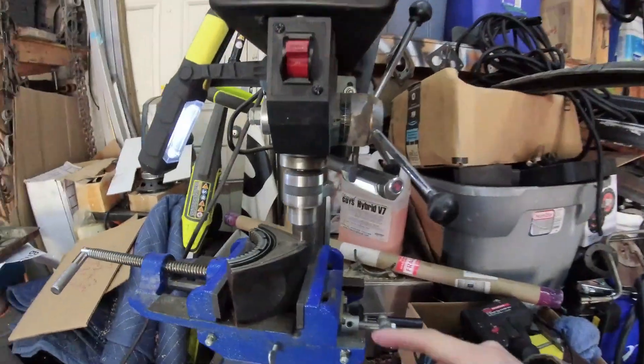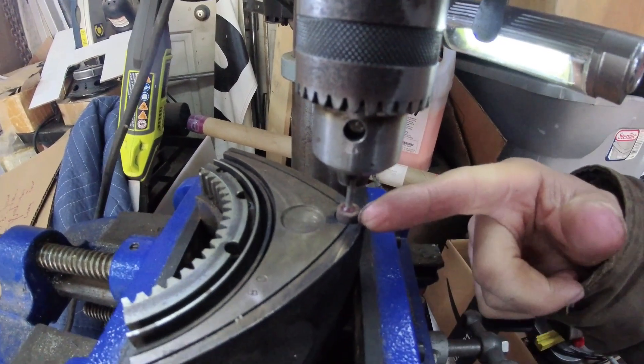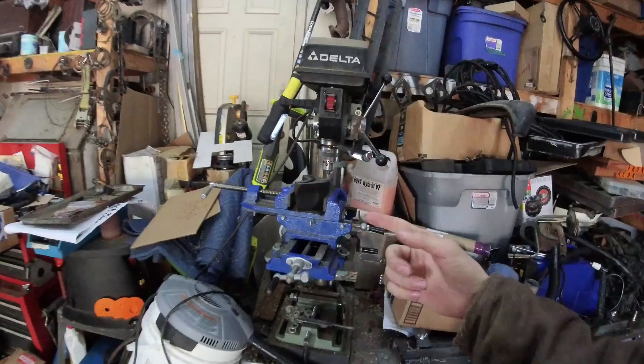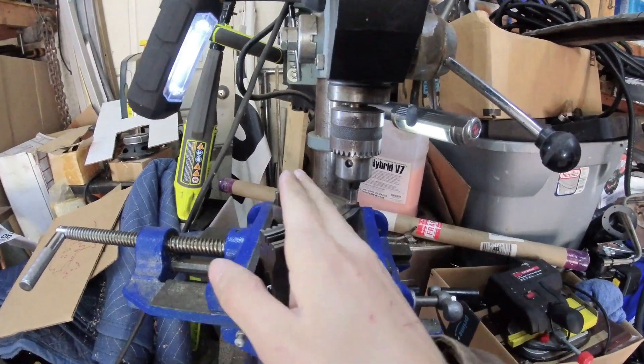You're going to need some way to effectively cut the seals. There are options like matchbox car-style tools, pineapple racing, bonsai seals, and others. The end of your side seal has to have a radius cut — not quite a chamfer — to effectively seal up against the corner seal, since the corner seal is round. We use a drill press for this.